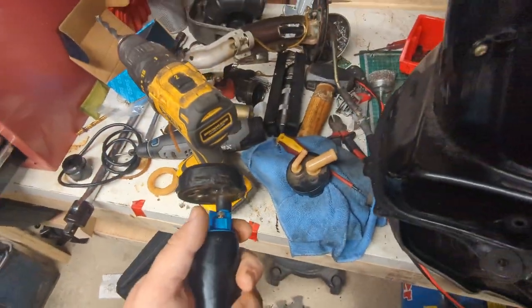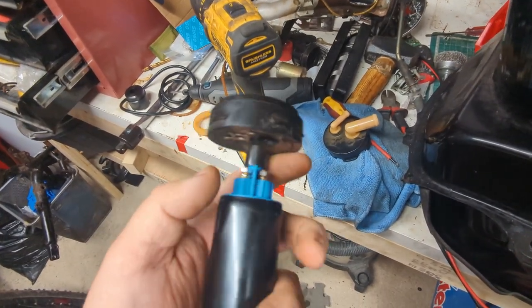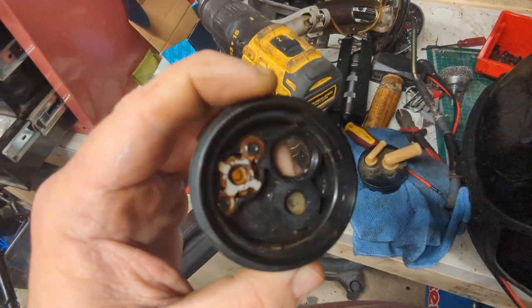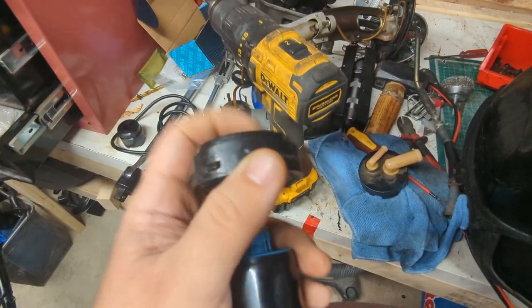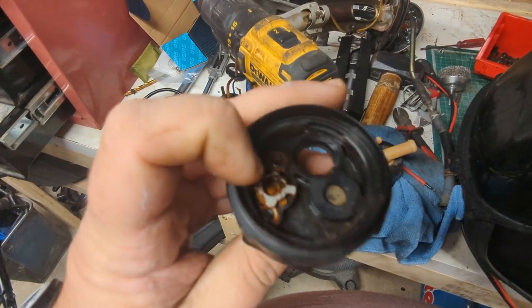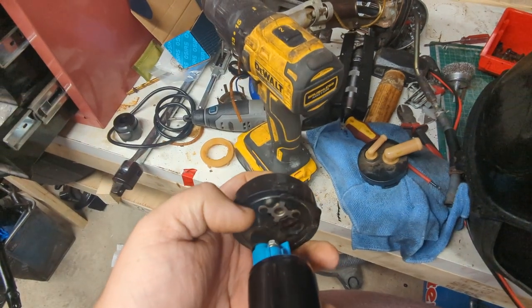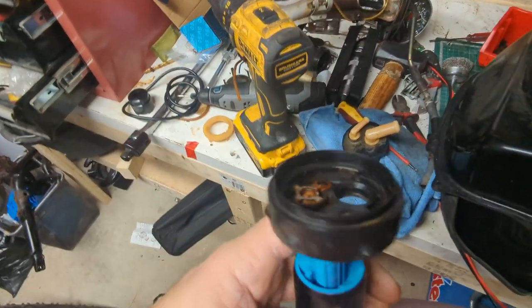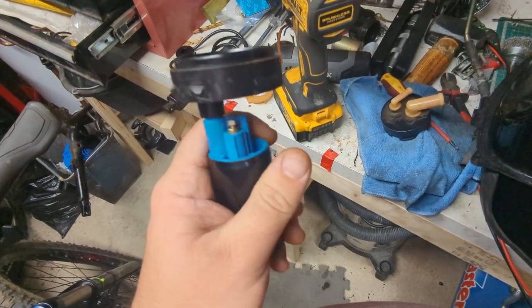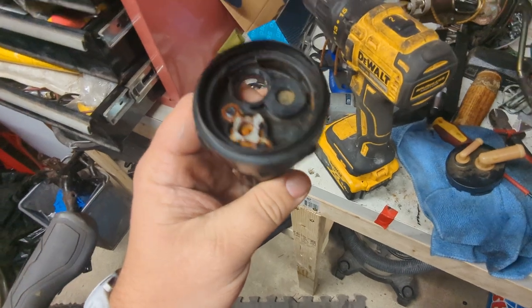So you're probably watching me futz with the fuel pump, and I couldn't leave it alone. This piece that held the original pump, I thought it must have something more to it, and it does. It's actually got an anti-return and an overpressure valve in it. The fuel is pumped into this spigot. It comes through here, that's the anti-return. And then this flap you can see is an anti-overpressure. It may also be a crude fuel pressure regulator, but a lot of people said that aftermarket pumps were pushing closer to 8 or 9 PSI to the carb when it's meant to be 2.